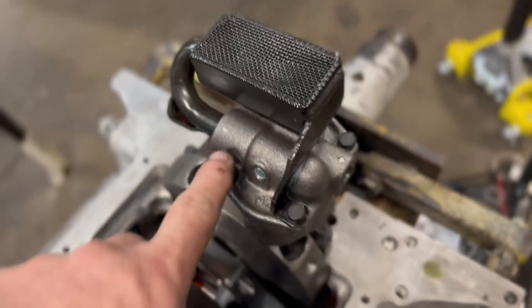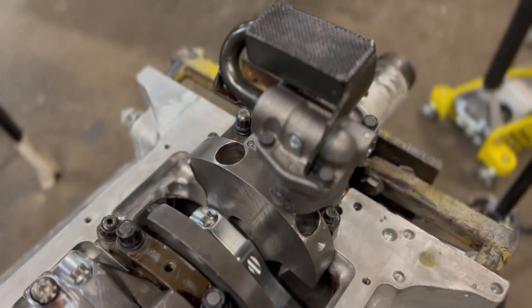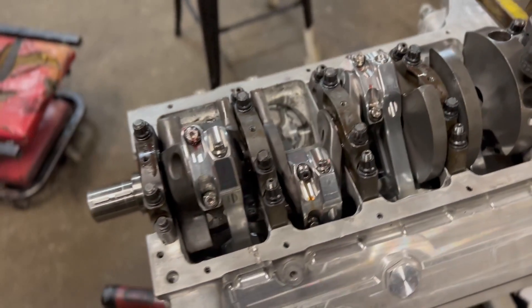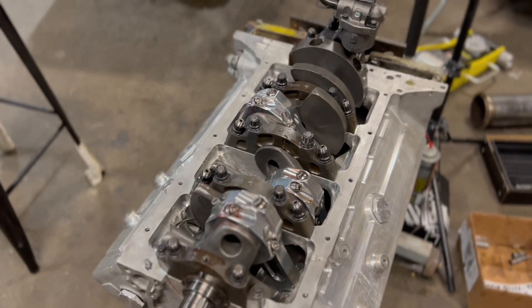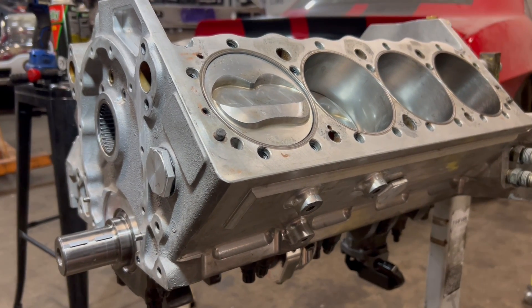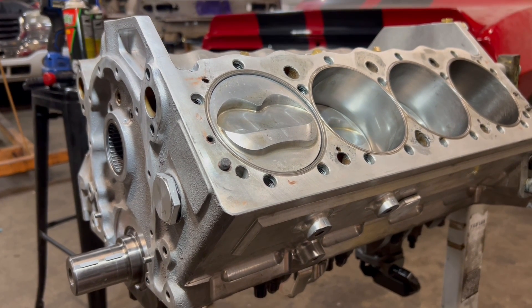The oil pump is on and mounted. We had to put the screen in — this is just for that pan. Generally when you buy a pan it comes with a pickup; if not, they do make special ones. At some point I'm going to get a billet all-one-piece oil pump, but that's not happening right now. Everything is retorqued to spec, so we're good there. I'm going to clean up the heads real fast — just spray them down and take a razor blade to get the copper coat off. Hopefully the compression is going to be fine. Alright guys, comment, like and subscribe — turbojohnracing.com — grab some merchandise. Don't forget November 26th, Knoxville Dragway, Turbo John's Backwards Brawl. See you next time.